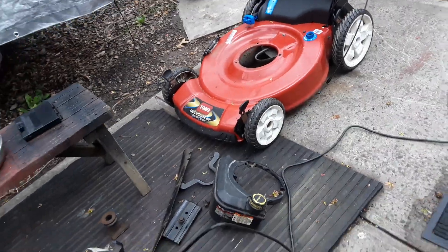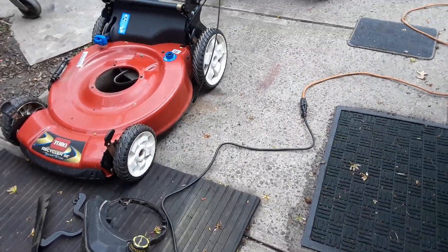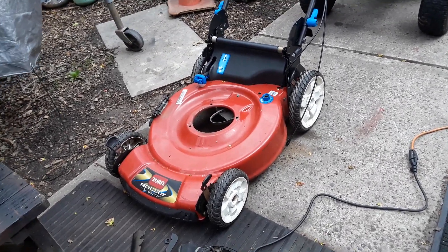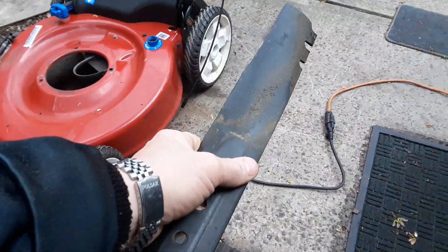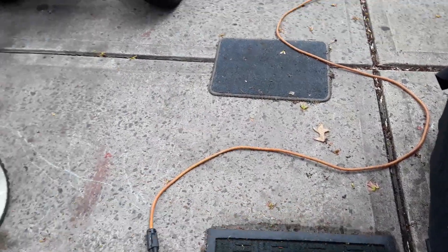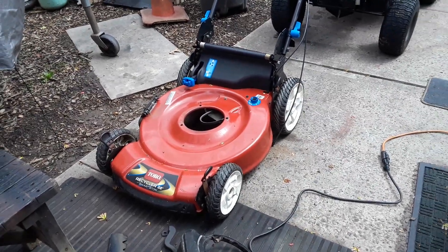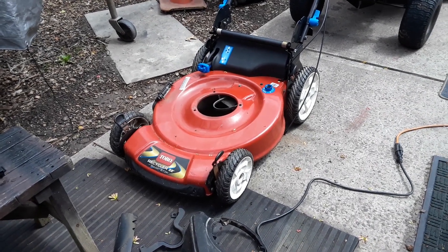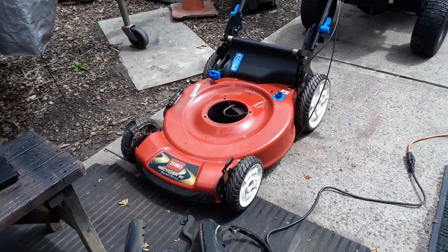You're always looking to get a home run — that's the goal. The faster it moves out the better. It's the first time in a long time I had one that wasn't done in a day, but the guy was a butcher. This thing is really weird because the blade is the original blade — it's still almost brand new, still perfectly sharp. So he must have from the very get-go not put enough oil or any oil in the engine and seized it from the very start — because you don't get a scored cylinder without low oil.